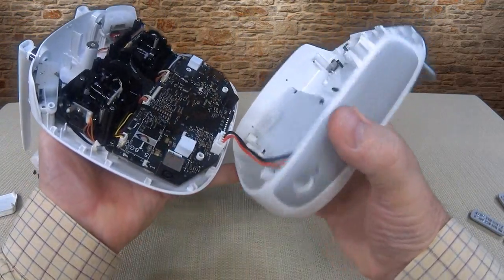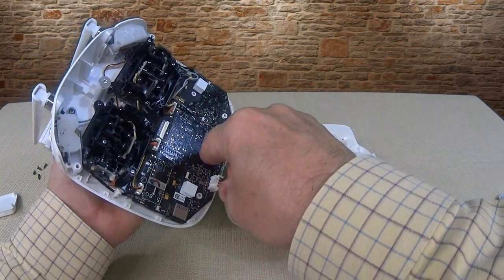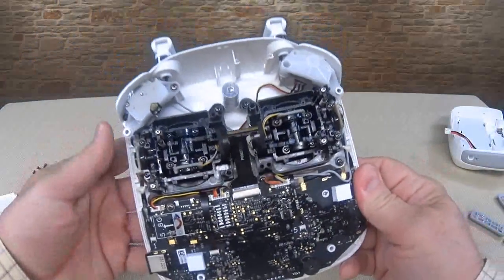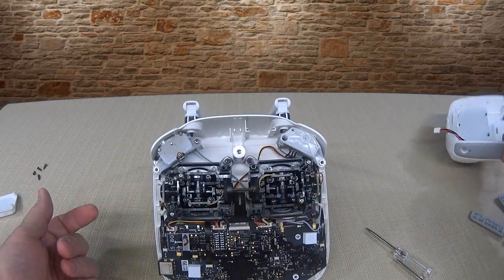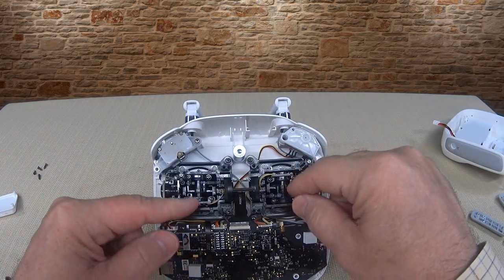Now once it's separated, you can see that battery I was discussing a minute ago is connected here. Just pull that loose. So there's a pinch here, and you pull that up, and it pops off. And then set that aside. And here's really what we're working with today. Now, as I said before, this is that flat connector that came through. You probably could have left the other 2 connectors on there, but I always like to remove those. I don't like to take any chances that I'm going to pull too hard and rip it.